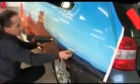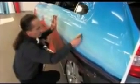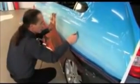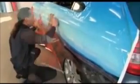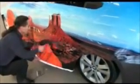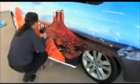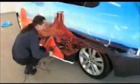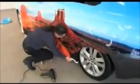Preheating the vinyl in large sections at 50 to 60 degrees C and generous squeegee movements are necessary to avoid tensions inside the vinyl. Special attention should be paid to avoiding overstretching of the vinyl by pulling too strongly. The vinyl is pulled downwards to be applied to the vehicle with slight tension, and then smoothed out in even movements with a squeegee, working from the centre outwards.